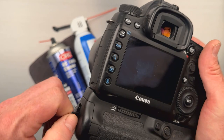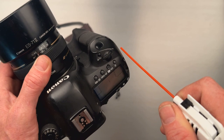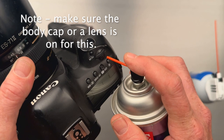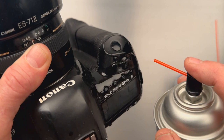First thing: turn off the camera and take the batteries out so there's no power going to it. Next, take the dust and lint remover and give it a little spray to make sure there's nothing in there. Then, take the QD contact cleaner and spray very, very little — it comes out very quickly — right into the wheel.